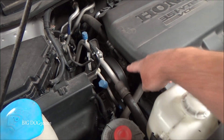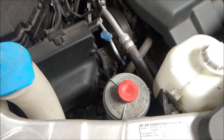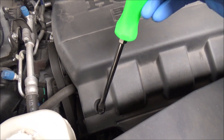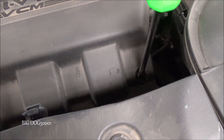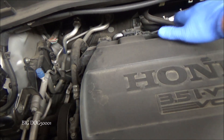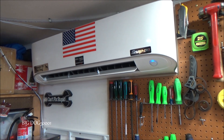Looking under the hood, there's our power steering pump that we're going to be replacing. And here's our power steering reservoir. We'll go ahead and get this cover off — we just need a flathead screwdriver. We'll just go in here like this on each one of these and now we should be able to just pop this off. It's over 100 degrees today so I'm running the AC unit, so you may hear some background noise.